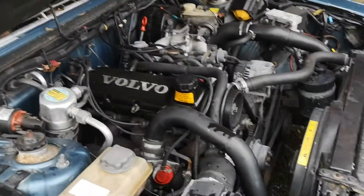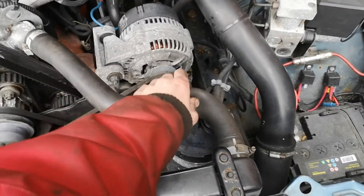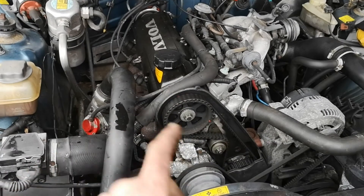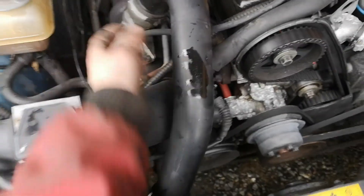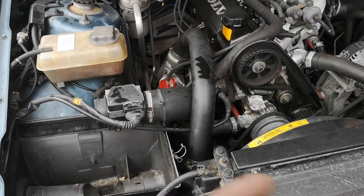We've been checking about everything and taking a few test rides, and so far it doesn't seem to be building any major pressure in the cooling system anymore. I checked the engine — the camshaft is alright. I checked for boost leaks, can't find any. I checked the bypass valve for the boost — that's alright, they usually crack in the rubber seal.